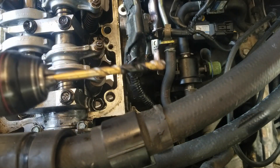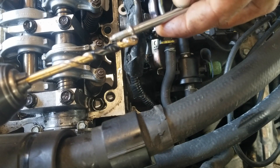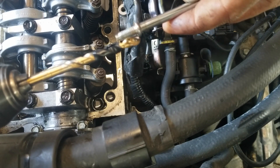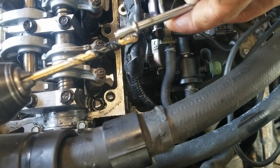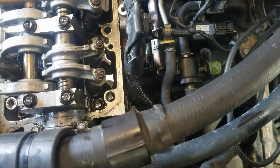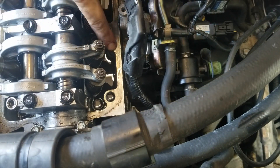What I've done here is take some electrical tape and mark basically how far down I need to go, so I can make sure I don't go any further than that. This is one of the valve cover bolts, so I just use that shoulder for a reference — I'm not going any deeper than that down that hole, because this shoulder is going to bottom out on the surface of the head.